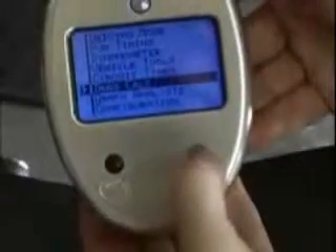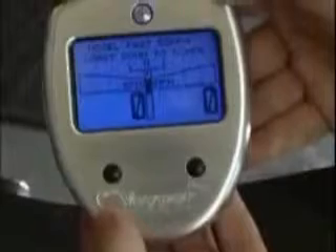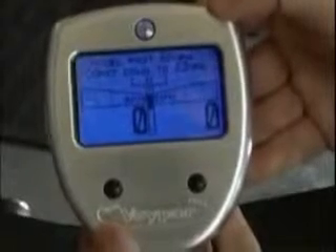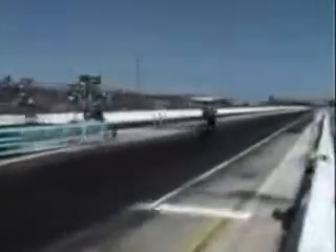Something of interest is the drag calculations. Everybody knows that aero drag creates a lot of issues with both your gas mileage, and if you're trying to go fast, aero drag is very important. So this will actually do a coast-down test and tell you what your aero drag is and what your rolling resistance is. This is some pretty serious information for the real gearheads out there. So you're telling me that I could actually see what the drag coefficient is of different clothes that I'm wearing, whether I put a fairing on it or not, or if I'm tucked in? Oh, most definitely, and there are a few guys in this area that are real serious drag racers and land speed racers. This is very important information. This falls into the category of the unfair advantage — free horsepower and free speed at the track.